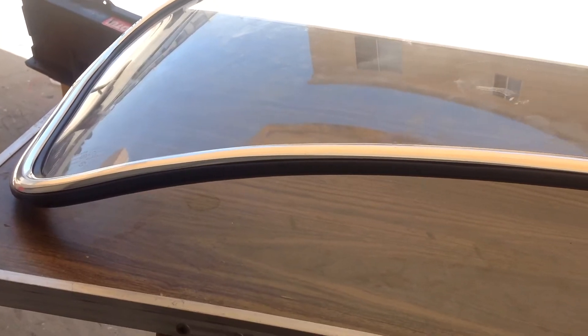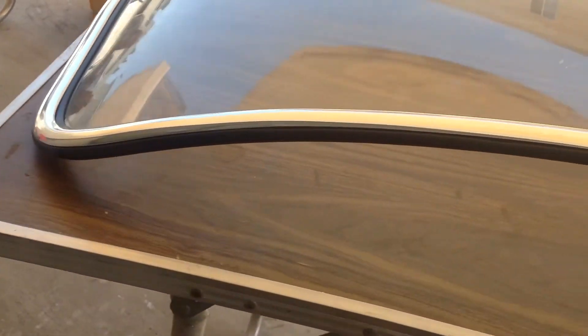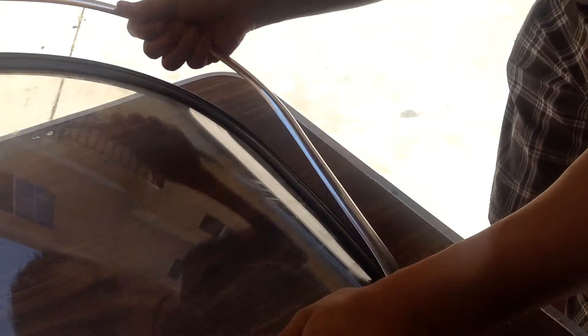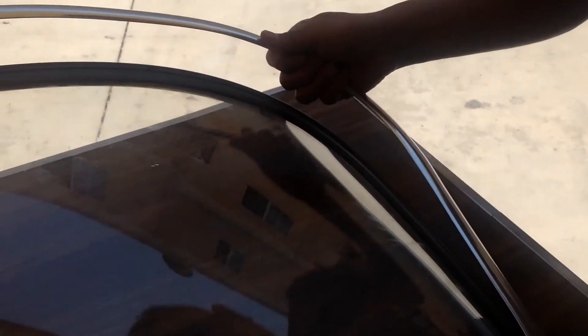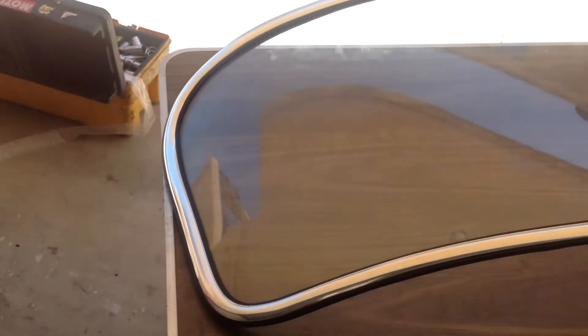And that way you won't have any problems. This is not a push-in piece of chrome — like a guy on YouTube who actually owns a company that sells this stuff. We won't mention any names. Karma Gear Parts of Restoration said it is not a push-in. You definitely have to pre-fit the aluminum, get the curvature of the aluminum to lay perfectly flat on the rubber, and that way you won't be fighting it. But it does look beautiful. By the way, this is not the die-cast plastic one that's chrome-plated — this is solid aluminum, so you'll have a good working room with it.